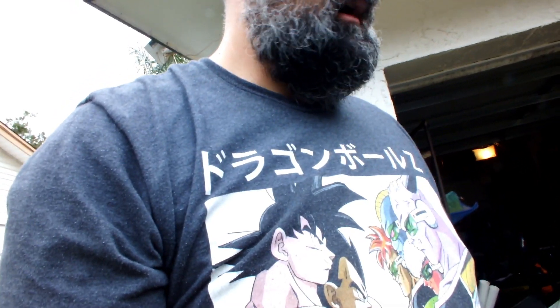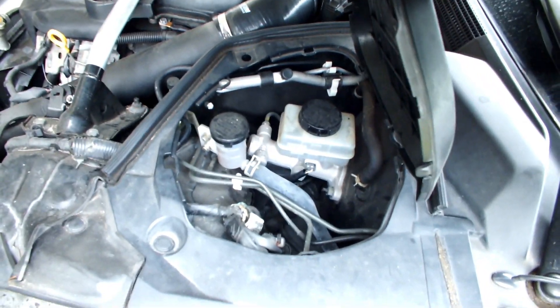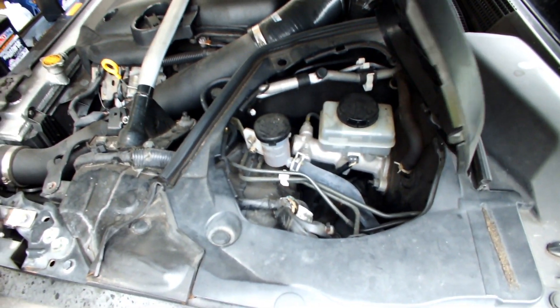I'm back. I went on a little grand tour of my area — and not dead. I'm just going to do an oil change real quick because I've got to drive up to Tampa in a week. The brake job came out fine — I bled it twice. There might still be a tiny bit of air in the lines, but it wasn't really spongy. It could also be because I don't have a front brace, so the firewall may be flexing. Everything's fine though — fluid is brand new and clean, and there are no leaks.